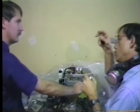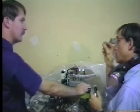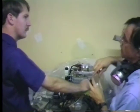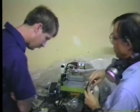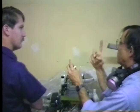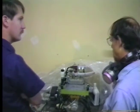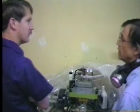There's the back. Do you remember the little cuff that goes around the gear leg itself? Yep. It's open in back, about a 1/4 inch gap back there, which is real bad. And it's intended... Pulling the outside air back around. Yeah, it's sucking it right in. So a piece of tape goes back up there, is all. And there's also a little fairing that I have to make up at the top of the gear leg. So I figure both of those little things together should be worth 3 or 4 miles an hour. I'm going to sand the airplane and polish it, which should be worth another couple miles an hour. So then we're up to 6 or 8.